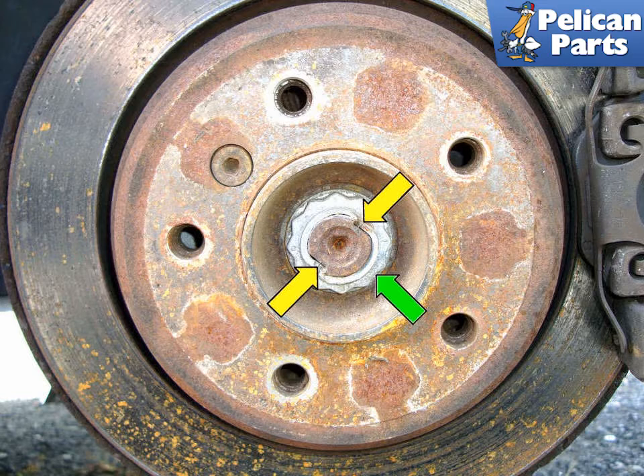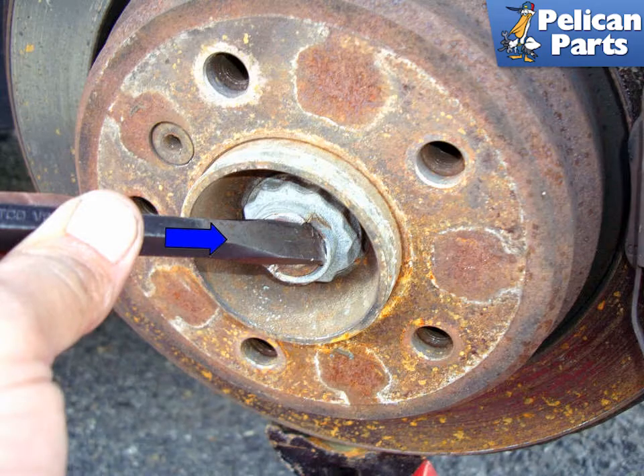This image illustrates the left side rotor. You need to remove the 36mm 12-point axle nut. Open up the locking tabs that pinch the axle shaft and prevent the nut from loosening up over time. Use a straight edge drift chisel and tap in the direction of the blue arrow to gradually open the pinch of the nut on the axle shaft.